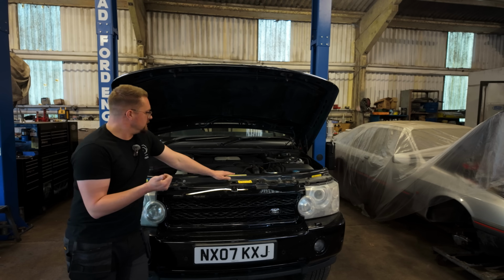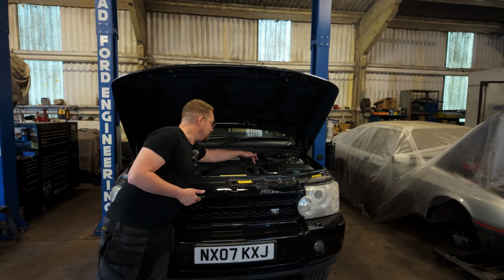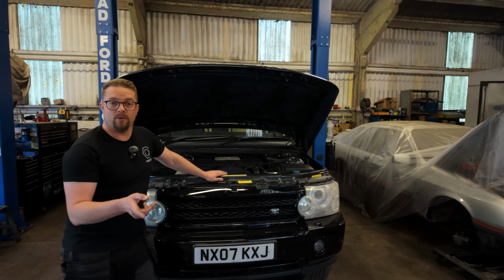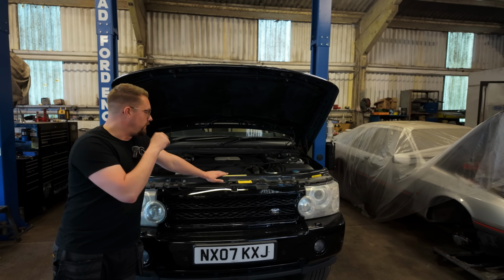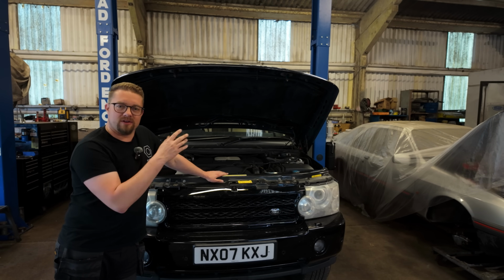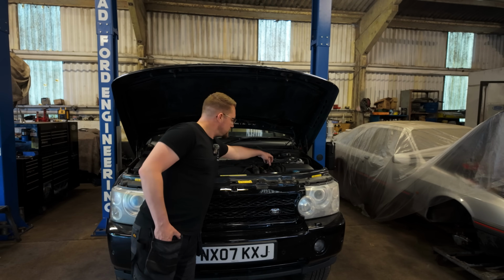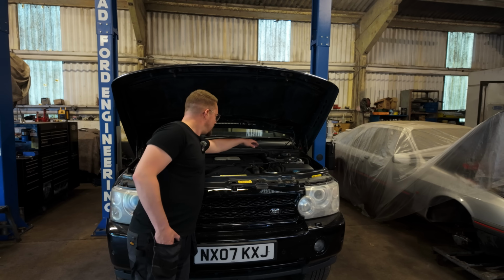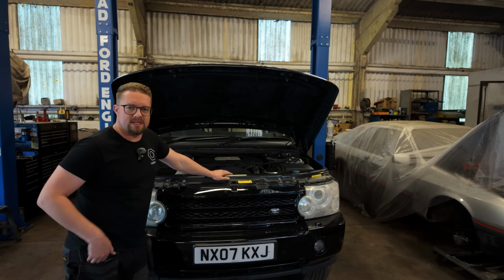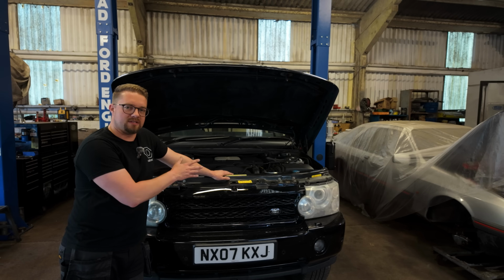So we've got a new battery, got some new intercooler hoses, because I think we've got a split on this one, actually. When we were out for the drive on the video, a warning light came up, and I said it was the fan. So that was a known fault on it. It then pinged up a load of codes around difference in pressure, I think it was, between certain sensors. And when I looked up the code, it said about the intercooler hoses. So got a set of those, replace them. Even if they're not split, it's good to know that they're done.